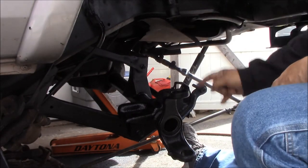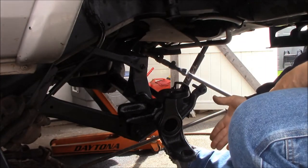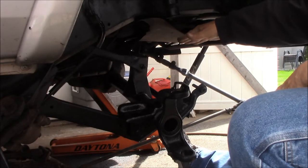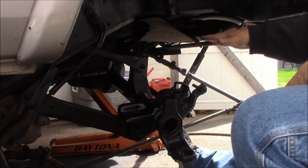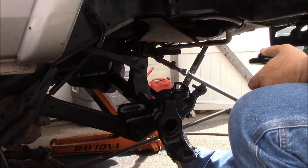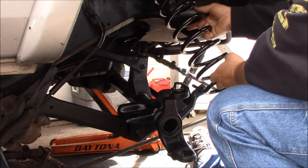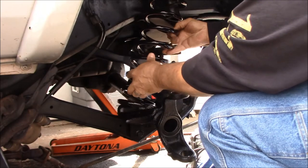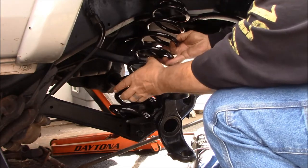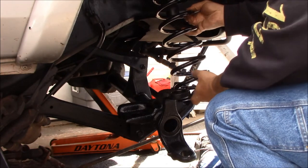I have the floor jack underneath the front axle, right where the ball joints are, and I've got it all the way up. Other than the track bar, there are no other suspension components hooked up — just the control arm. This is pretty much down as far as I can go. So if I take this coil spring and slot it up, I'm close to being able to get it in. I'm just trying to find the best angle — coming in from the front here seems to get me close.